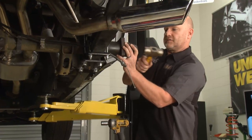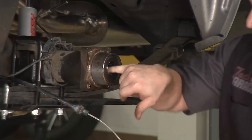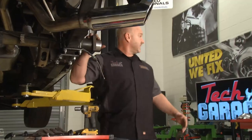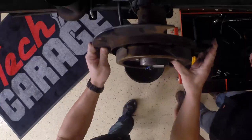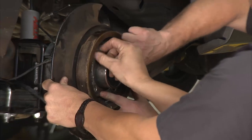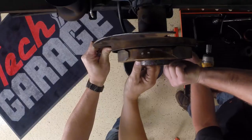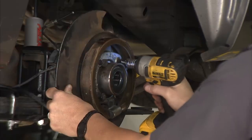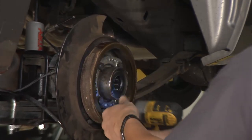A little TLC to get it seated with the right tool. There's the new seal, there's the new bearing — that's in great shape. We didn't have to prepack it with any grease because the differential fluid is going to do that job. We're ready for the backing plate. Emergency brake, nothing to it. Cable bracket down. It's so nice going Chevy to Chevy here — it's going to bolt right up just like it was. It's the same differential, just a different backing plate configuration. Now we'll tighten that up and make sure that's secure.